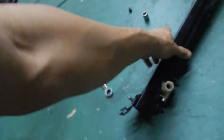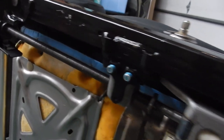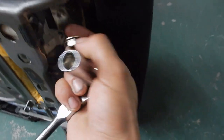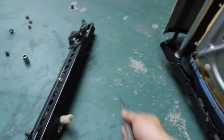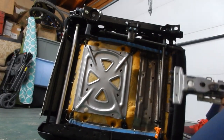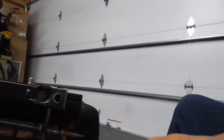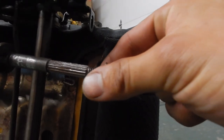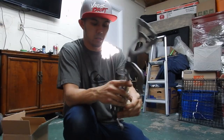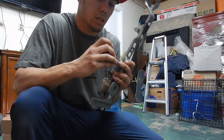There's a bolt right in here that moves the threads which adjusts the seat rails, so you'll need to adjust it all the way out. There are two washers - one has a bigger inner diameter so it slips over, and the other has a smaller diameter. Now we're going to start with the motor, which takes two Allen key bolts - looks like a six millimeter.